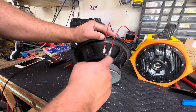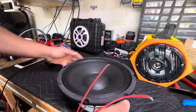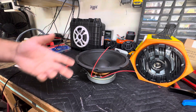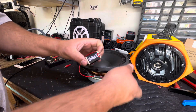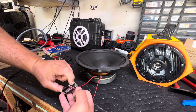A quick fact on the speaker: the left is the positive, the right is the negative, but sometimes that can be reversed — and this is a good way to find out. Also, if you're using a multi-conductor wire, you're not always going to use the same color wires for every speaker, so sometimes they get confused. So: positive, negative — just tap it. You'll see the speaker is going to move up.